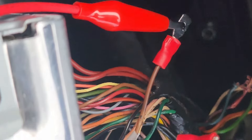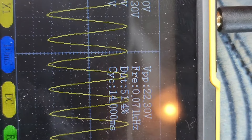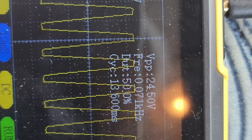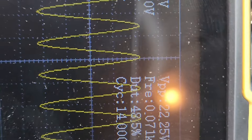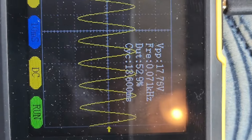I've got my oscilloscope out — got it connected with my leads. You can see it's clean at volume 40, 41, 42, 43. It starts to clip at 43, 44, 45 — we're clipping hard. We're at max volume. I could actually do 42 but just to be safe we're going to stick with 40. We've got a clean signal at 40.